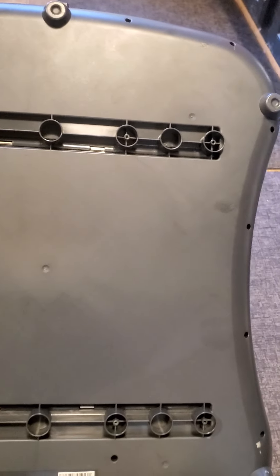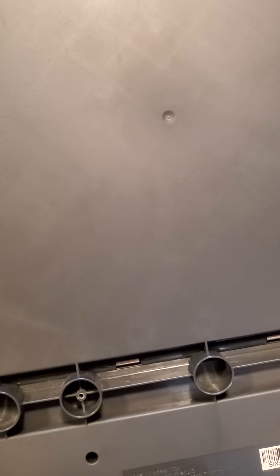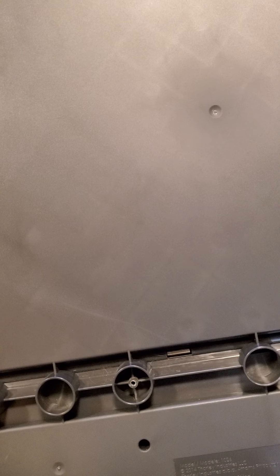I've flipped it over on the back and already removed the screws, but there will be screws here and screws around the base of it — lots and lots of screws. The reason this made its way to me is it was showing an error code: two little bars illuminated, and then it would just turn on for a moment and shut down, turn on for a moment, shut down. There is something you can do as a temporary fix, and once I flip it over I'll show you.